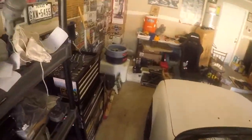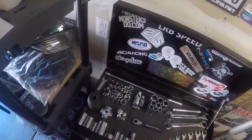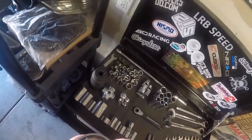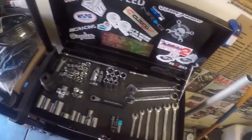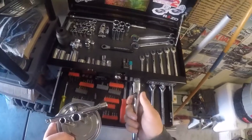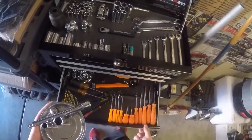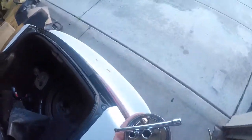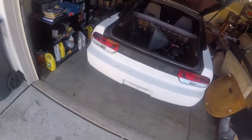This is generally what you're going to need to take apart a lot of these. I'll take a deep 10, a small 10, and a deep 14. I'll take an extension just because I always make use of extensions. I heard this thing weighs like 40 pounds, so I'm going to end up coming back over here and putting a jack on it whenever we're at that point.